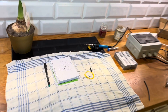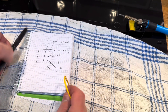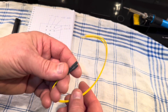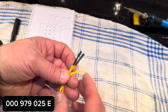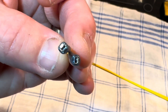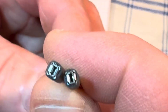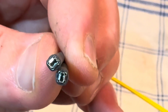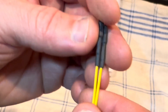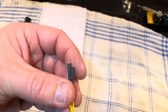So now we are in my kitchen and my wife is not home, so I think we will be able to pull this off really smoothly this time. Jokes aside — here are two repair cables from Volkswagen. You will find the part number down in the description. Taking a closer look at the pins, you can see that they are rectangular shaped and I think those will fit really nicely on those pins and not float around too much. I've also put some shrink tubes around them so they will be insulated and not short anything out.